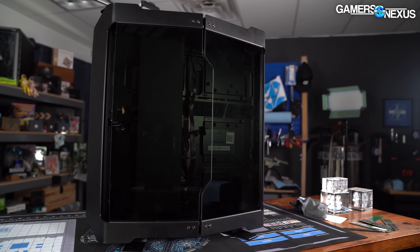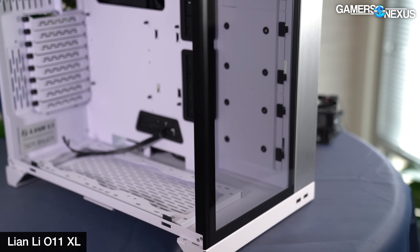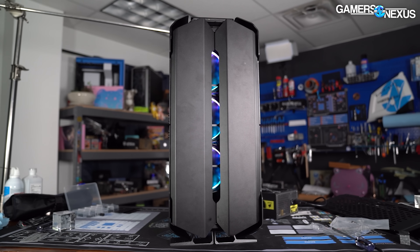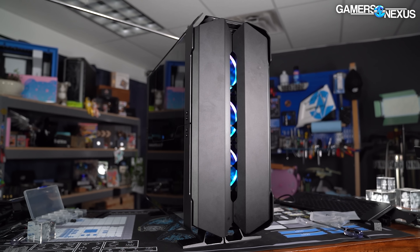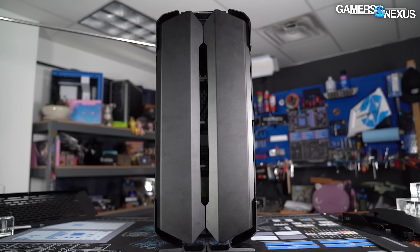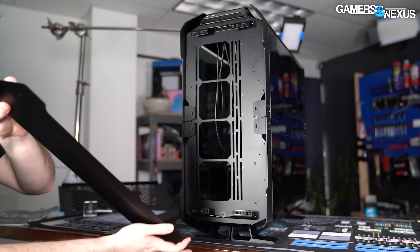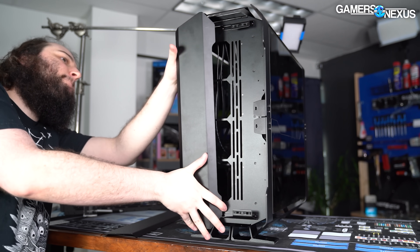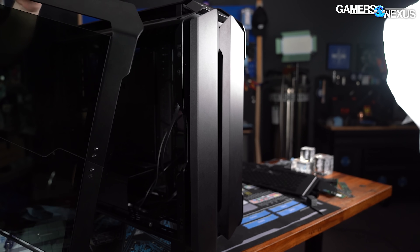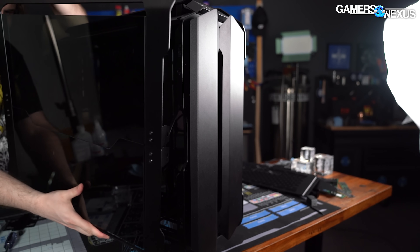Starting with the Dynamic layout, the side, front, and top fan slots are usable. Unlike the O11 Dynamic with its sealed glass panel, there's no particular reason to use the side fan mounts other than to show off RGB fans — which aren't included. The front and top mounts are more open. Front fans of any size won't line up with the front panel, so installing RGB fans here will only draw attention to the unintentional asymmetry. The two aluminum sections that make up the front panel can be installed like closed parentheses — leaving a gap in the middle over the fans — or like open parentheses, hiding the front fans from view entirely. We performed thermal testing with the closed parentheses style. The panels use tool-less snaps at the corners, but the heavy glass and aluminum panels are unwieldy compared to the hinged panels of the C700P or simpler panels of the Meshify 2 family. The tool-less nature is also a lost benefit since thumbscrews should be used to ensure the panels remain perfectly flat — they do bend at the center.